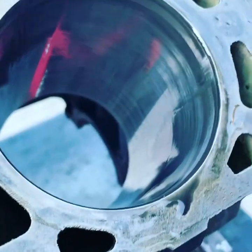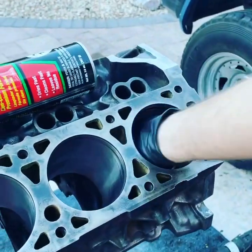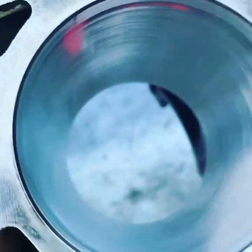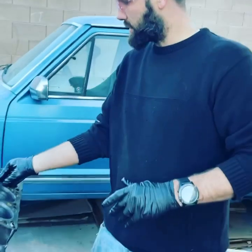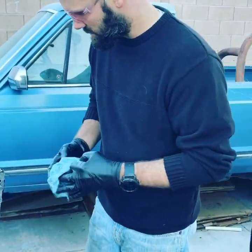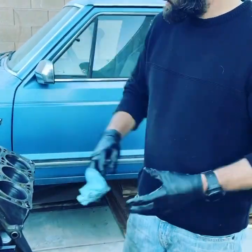It is nice and honed out. You don't do this to increase the size of the bore — it's to smooth everything out. It'll actually show you inside the bore if there's any major issues that you need to have fixed, which in this case I don't see any issues. That is how you hone a piston bore.